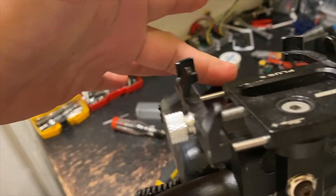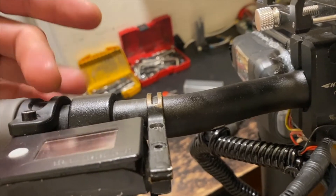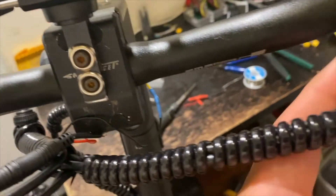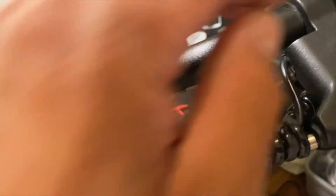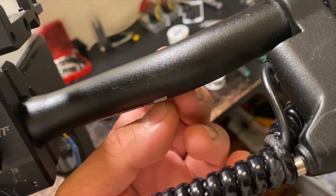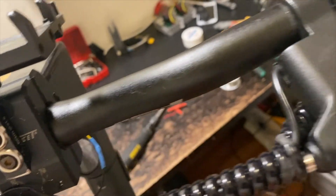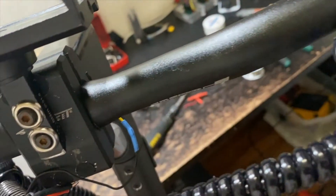So your connections — you don't need to actually go inside the dashboard to do those connections. As you know, from the regular scooter, regular connections also have a throttle, and the wire runs along the handlebar. Also from the brake lever a wire comes like this that runs along there. So what you're going to need to do is loosen the cable screw from here, loosen up and get close to the lever so it gives you a little bit of space to take out the wire, and then peel it off and remove it until you get to the wire.